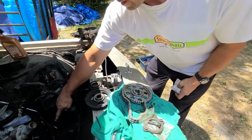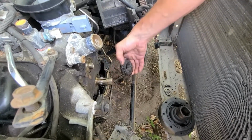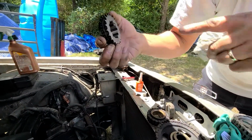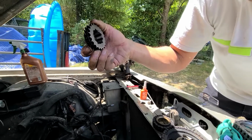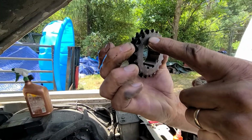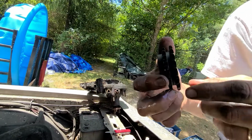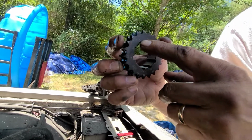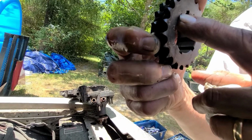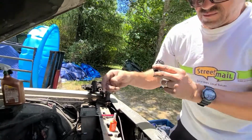So I've already got the bottom sprocket. You can't really see it. I'll slip it off. See, it's the 0. When you got all these positions, you put the 0 up. The A is advanced, 4 degrees, 6 degrees, and you could actually keep indexing it, but we're going to 0. Here, I'll show the numbers, because I've never known that there was numbers on the back of that. You could put it forward to, or you could put it back to. You could put it back, and you could just pull it off. There's only one.